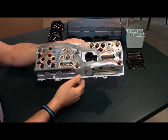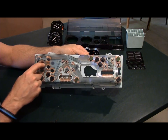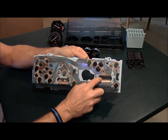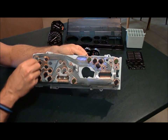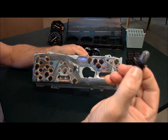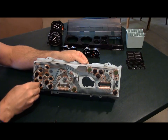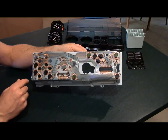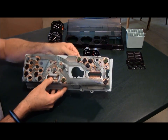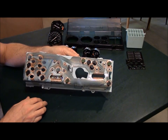Flip it around to the back side — here's your printed circuit, and again it's 25 years old so be very careful with it. What I'll do is on the different contact points, clean them up a little bit — maybe with a small piece of Scotch-Brite, just enough to scuff them to make sure they have good contact. If you take one of these bulbs out, on the back side you can see two metal contact points on either side that make contact with the printed circuit — that's how it gets its power. I would suggest replacing all the bulbs regardless. The last thing you want is to put it back together and have a bulb blow out a week later. Also take a photograph or make a chart of where all the bulbs are so you don't get confused when putting it back together.